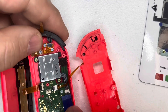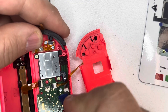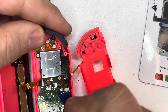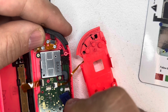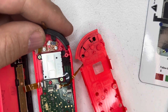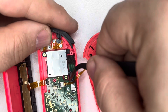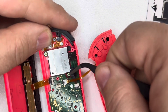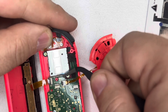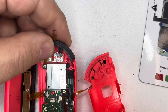You also need to remove the ribbon cable that goes to the analog joystick itself. Go to the tab on this plastic port and move it up gently. Then take the tweezers and pull it up and out. You can see that it pulled right out of there, and now you'll see the two screws holding in the analog control thumbstick.